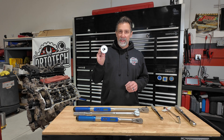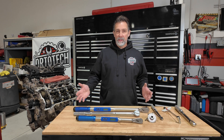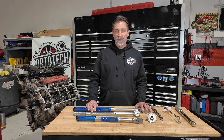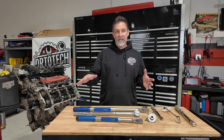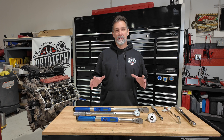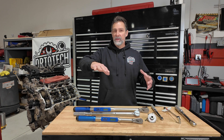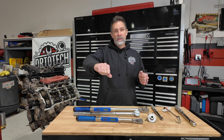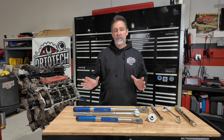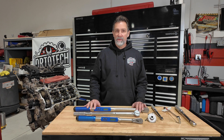That's really not the best way, and that's why I've upgraded to these digital torque wrenches. These have torque angle measurements that are very precise — they allow you to stop and start again and still measure exactly the torque angle you need. They also allow you to ratchet. So if I'm underneath a hood tightening something in a tight space, I can go a little bit, come back, and go a little more — and it's still going to precisely measure the torque angle.